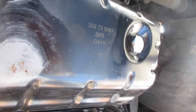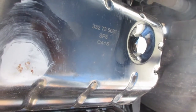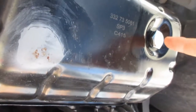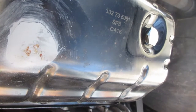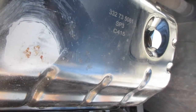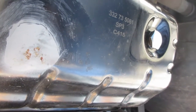We're just about to unscrew the bolt on the sump of a Volvo V50 to do an oil change. This is the sump, and this is the bolt we've got to undo. I've already taken the sump shield off the bottom of the car, so the next job is just to undo that and let the oil drain out. I've already brought the engine up to operating temperature — it's always a good idea to do that first so the oil drains out nicely.